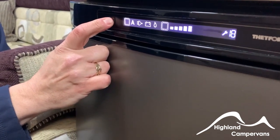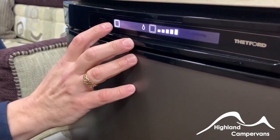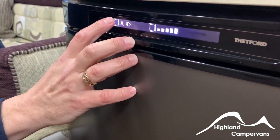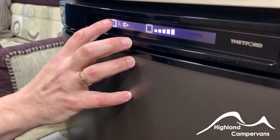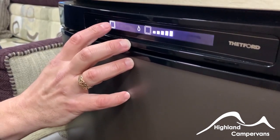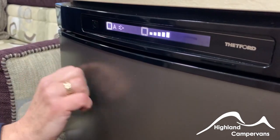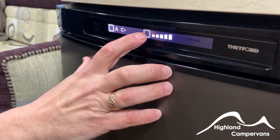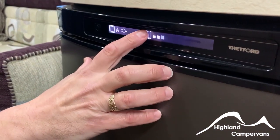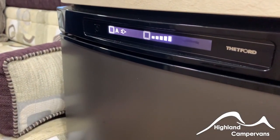Underneath the adjacent bench is your mains cable and leveling wedges. Your Thetford fridge has a raised switch at one end to turn the device on and off. Beyond that, a touchscreen facility lets you choose between modes — mains, battery, or gas. There's also an automatic mode where it changes subject to available energy, and an adjacent control for the thermostat.